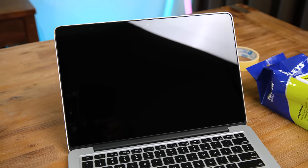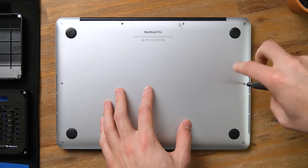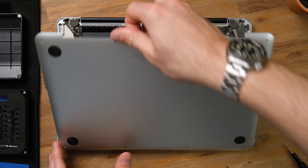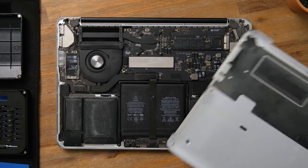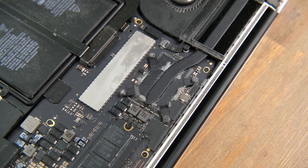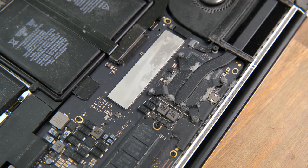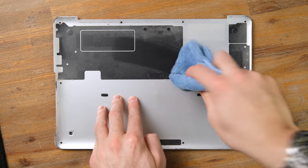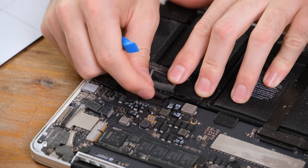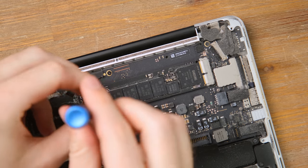So far I haven't even opened the laptop up, which is usually one of the first things I do. It was missing one of the screws, so I assume the original owner had opened it up at some point. And it's a really dusty Mac. This is caused by the air being pulled through the vents on the sides and forced upwards and out by the single fan. Later model MacBooks did away with this airflow design — the newer MacBook Airs, for example, have no airflow at all and are completely fanless. Before you work on the internals of a laptop, make sure to disconnect the battery.